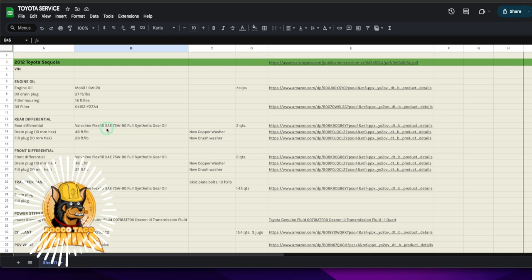Having said all this, I decided to put together everything I recently did on this Sequoia because the goal is to make these cars last. I'm going with the 5,000-mile oil change — or whichever comes first, six months. I used to let it go a year; that's bad. Now I'll get on a six-month schedule. I have all the tools in one bin — sockets for spark plugs, the oil filter cap, a breaker bar.